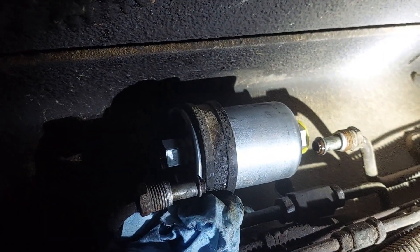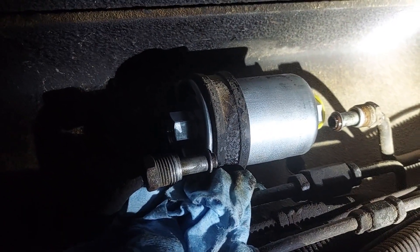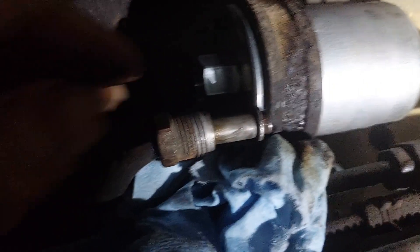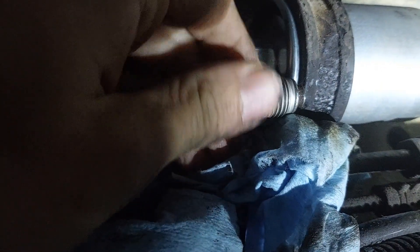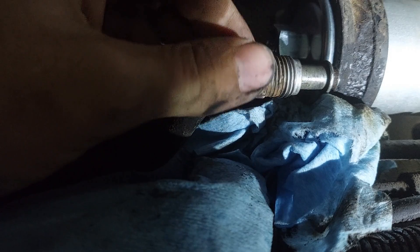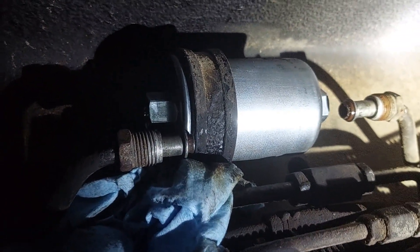Alrighty, the filter is now in. I had to loosen the clamp slightly to get enough wiggle room to slide this in the front like that, but it is in. I will just go ahead and take the caps off and then slide these lines back in position — get them on flush since they are compression fittings — and just tighten them back up. Remember, you need a 5/8 line wrench for this guy, and I am using a 21mm for the nut that is actually on the filter. And that ominous creaking you are hearing is the airbag slowly leaking down, so I kind of need to finish this before I almost get pinned under here.